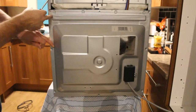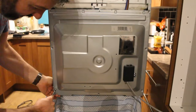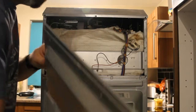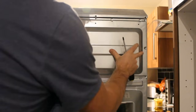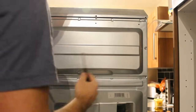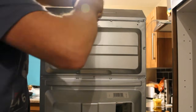Pull the door shut, making sure you're not catching anything. The best one to put in first is the one down the bottom — do it up nice and tight because you don't want it to rattle. Carry on with the rest. For this piece, there's a lip on the upper edge, so the lipped piece goes at the top. Get one screw in, then go around and do the rest. Leave the top ones to last because you need to pull the top down to clip it all in.